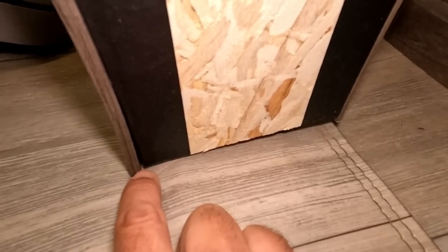This piece of wall or trim is longer than the other piece and it's just digging in to that linoleum right there, and when it digs in it causes that to crinkle when the slide comes all the way in. So what we're going to do - John is going to cut this off and just kind of trim this wall down a little sliver and see if we can relieve some of that pressure. It's like that on both ends of the slide - on this one it's not as bad but it is still digging in a little bit. It looks like at the factory when they made this RV they had shaved it off a little bit because it was too long on this end, but I don't know if they shaved it off enough.